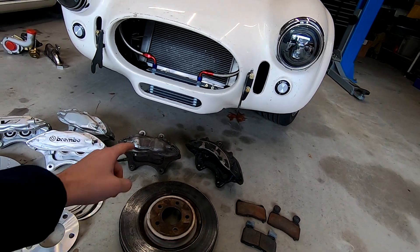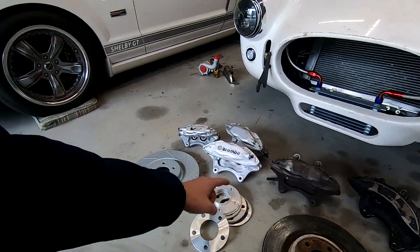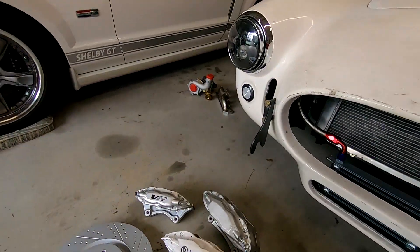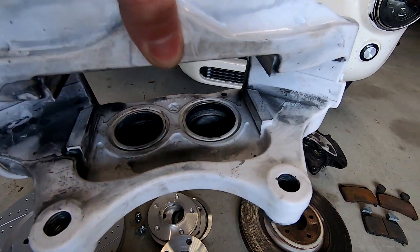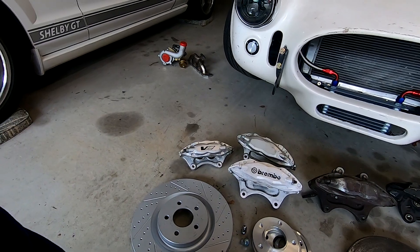Another type of caliper you can get would be your average Camaro caliper. This one was powder coated — one of those situations where 'oh hey, I know a guy that can powder coat my calipers for a hundred bucks.' What ended up happening is powder got inside the bores, and when that happens the pistons will leak. When you hit the brakes your foot will go to the floor because there's brake fluid squeezing right out. This is an example of something you could probably buy used on eBay.